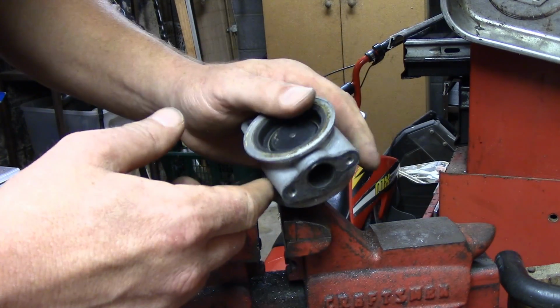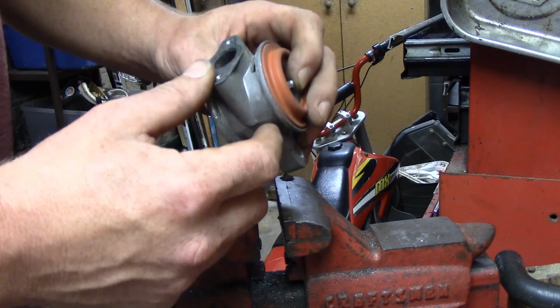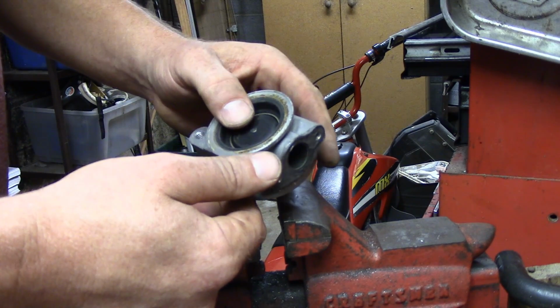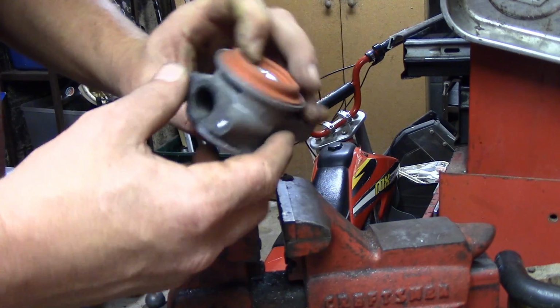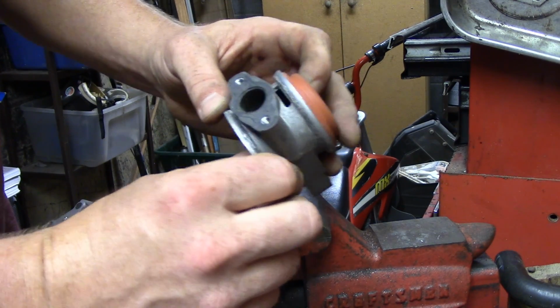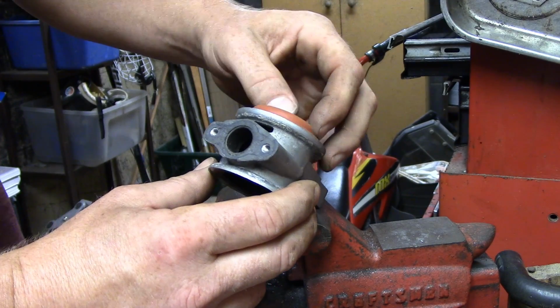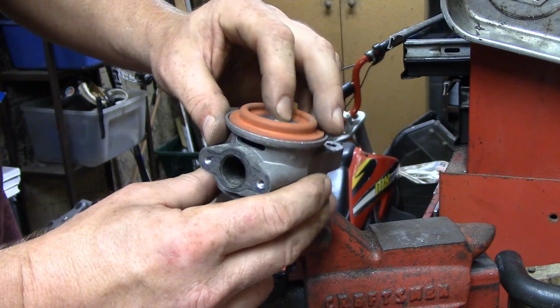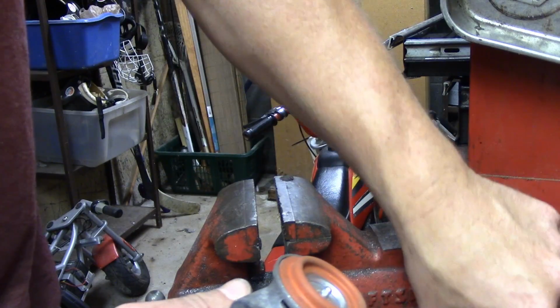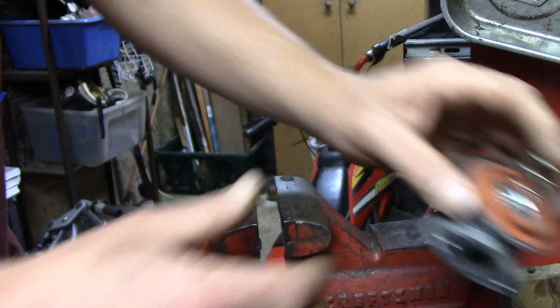Well, some bonus footage that all that's going to do is make you guys question me on my repair. But I promise you the vehicle is fixed. And it has to be that this valve is sticking. And the clicking I was hearing was maybe partial movement or just the diaphragm flexing and releasing. No other explanation for that. Alright,